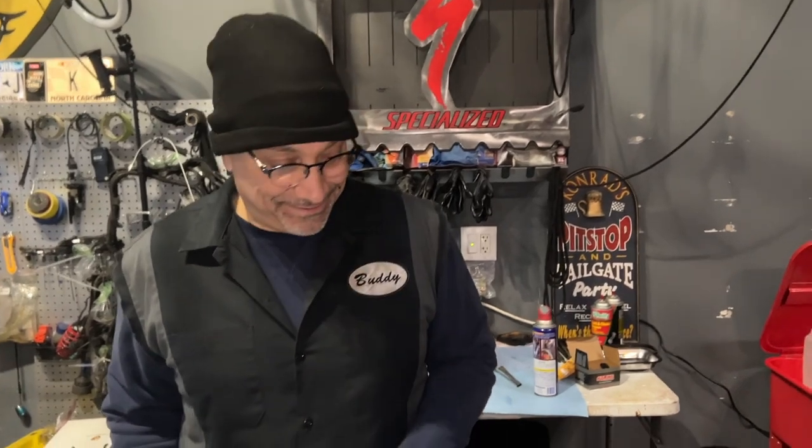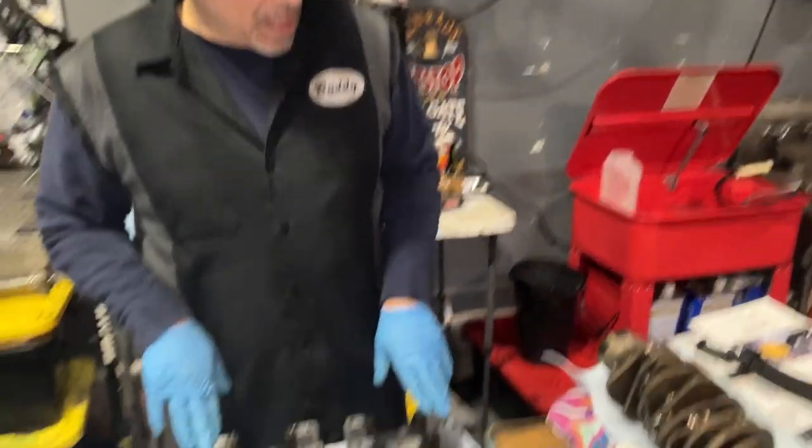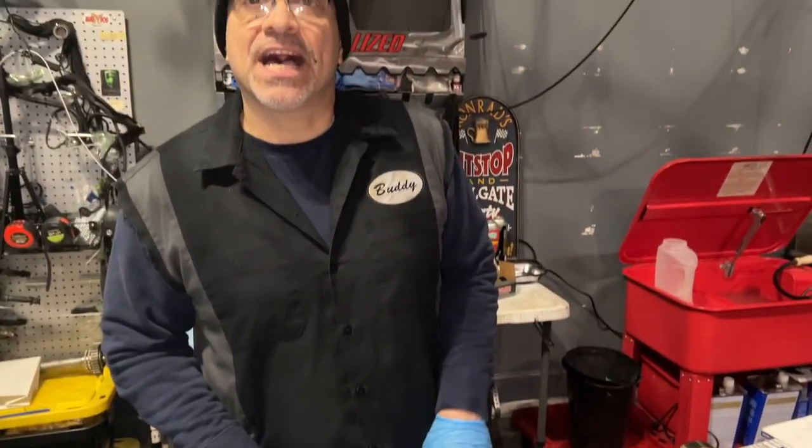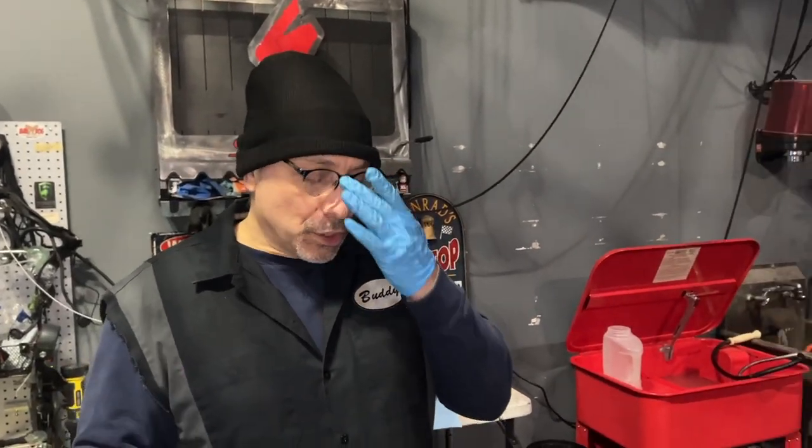This is my buddy Conrad. Hey, how's it going? So tell us a little bit about the car that this came out of. So this engine came out of a 2005 Porsche 997.1 Carrera S. It's a 3.8 liter, 130,000 miles, was billowing smoke, not running well, tons of codes, suspected problem with the engine. Got in touch with a whole bunch of people in the Porsche community, and they said, well, you probably have a cracked cylinder, might have a potential de-chunk.